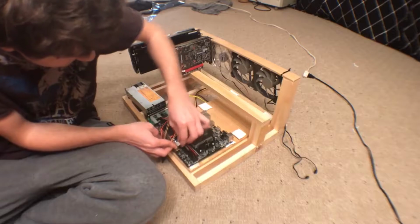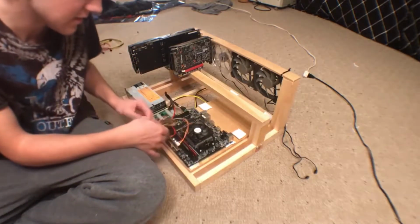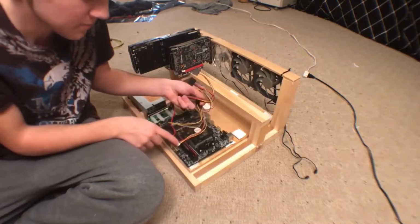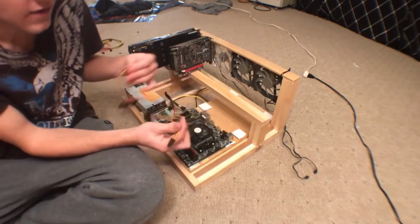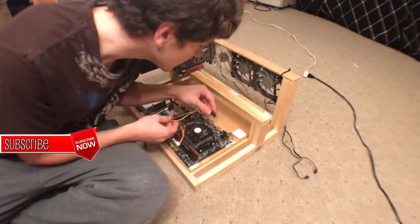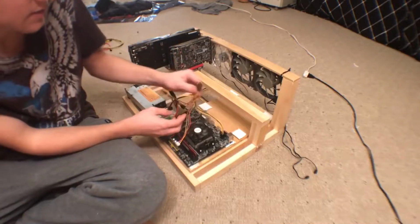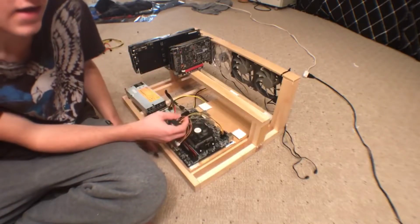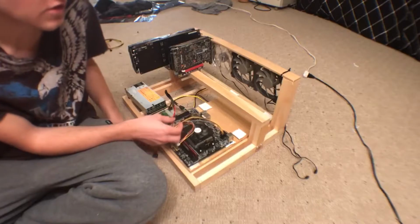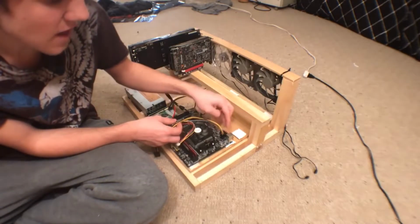So the Pico will power the power supply, and then it has a little extension cord which will actually lead over to a 4-pin CPU cable, and then it'll also give you an additional Molex, and then it'll also give you 3 SATAs. Well, I wouldn't just power a bunch of things off the Pico because it's only rated for 180 watts. But you might be able to power the motherboard, the CPU, maybe a fan or 2, and the hard drive.